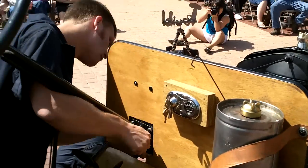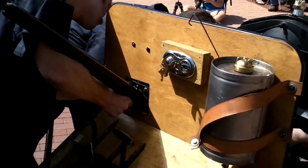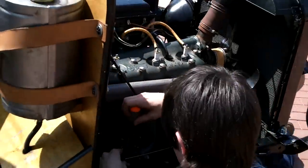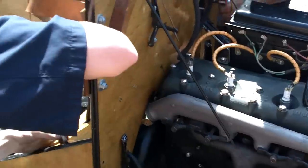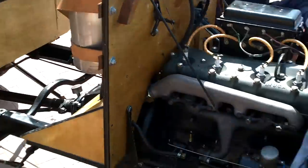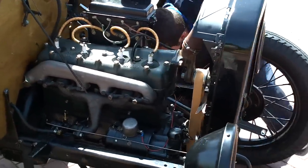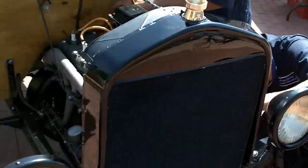This, you used your foot. In the 40s, 50s, 60s, they use hydraulic fluid. Now they use an electric solenoid, but it all works exactly the same. Something that was pioneered by Ford. It's a bulletproof design. And then the third pedal in the center was your reverse. You would hold your clutch in the middle and then push the pedal in the middle to go backwards.